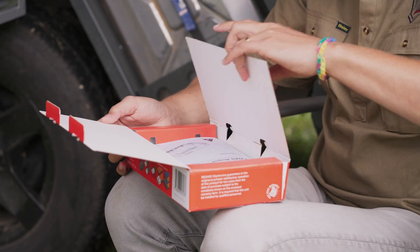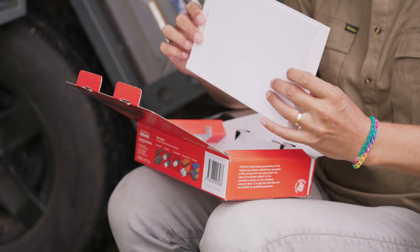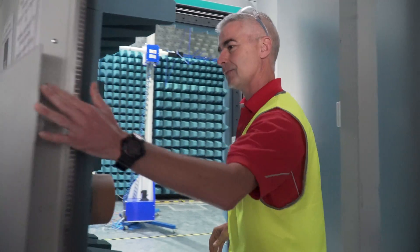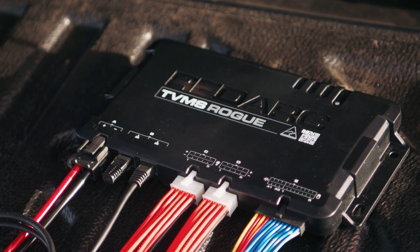What's in the box? You get the main unit plus the connectors — you can see the image on the side of the box — and instructions. All connectors are included; they are standard automotive-style Molex connectors, so you can configure the product as you see fit. There's color coding for inputs, outputs, and the analog to digital inputs. Those analog inputs are great for water tank sensors, such as float sensors. RedArc puts everything through the same EMC lab testing processes, with the same guarantees and warranties — and not only for Australia, but exported to the US, Europe and other parts of the world to meet all those standards.